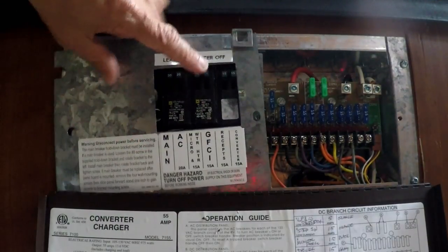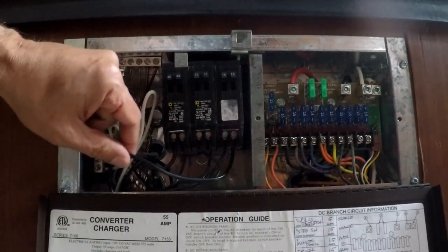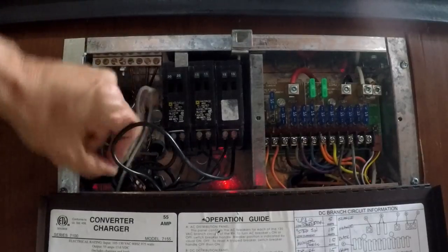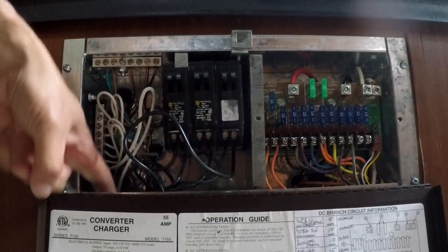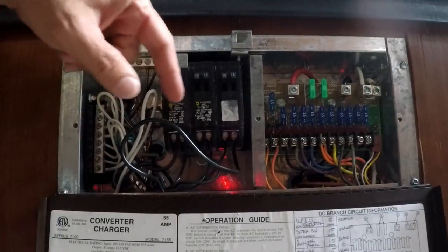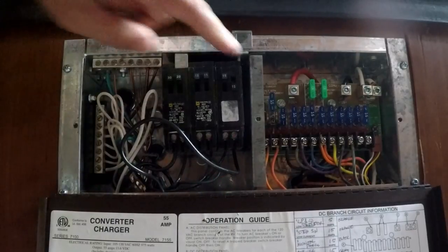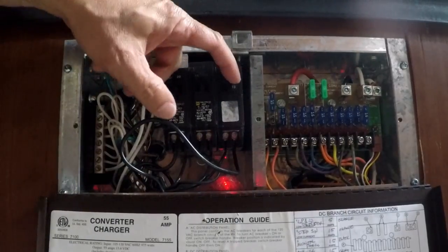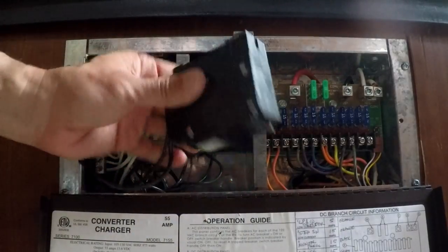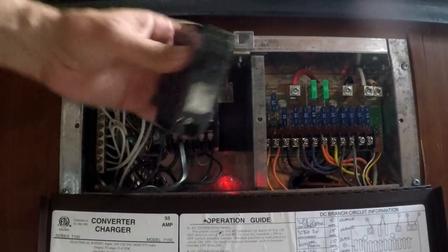Here's the box. I'm going to wire this in here and attach it to the wall behind the circuit breaker panel using heavy-duty velcro. This is the actual breaker where the converter charger is powered from. Following this wire down, I can see it goes down to the charger unit. I'm simply going to disconnect this and tie it into the relay, then take the other end and connect it back into the circuit breaker. Normally I would shut that breaker off when running on my inverter — it's just a regular AC breaker.